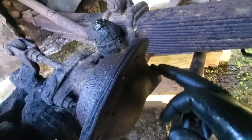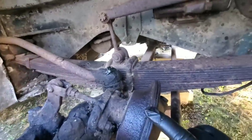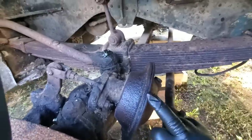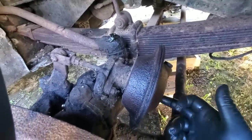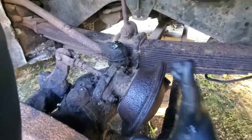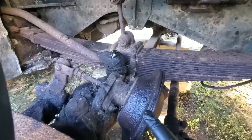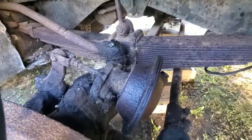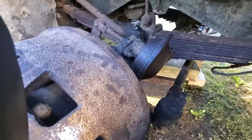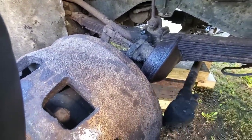Today's first project: the airline broke off in the back of the brake chamber. We can't put a lot of heat to it because we don't want to damage the diaphragm. If we try to drill it, it's going to put metal inside. So we're just going to take it apart. We ordered a new diaphragm from Luke. I just hurt myself — my wrench slipped and I smoked this finger into a brake drum, so we're taking a little break.